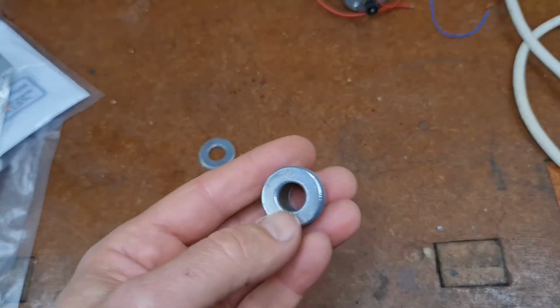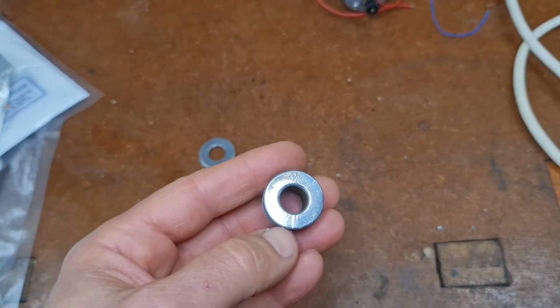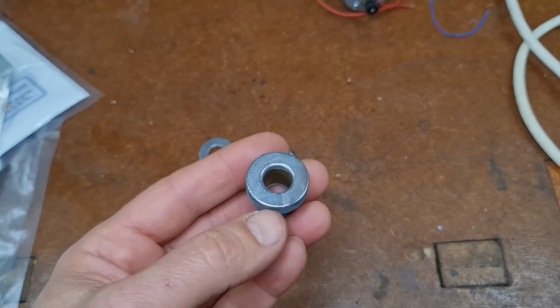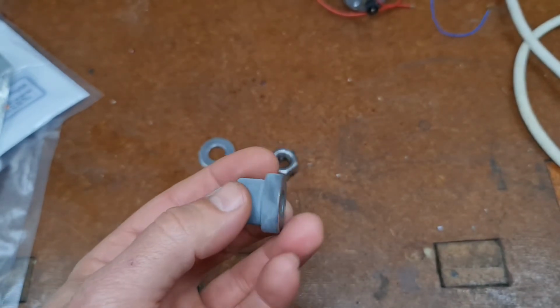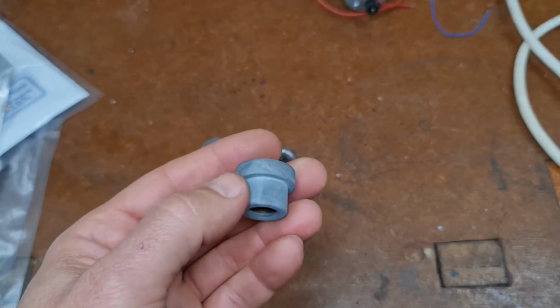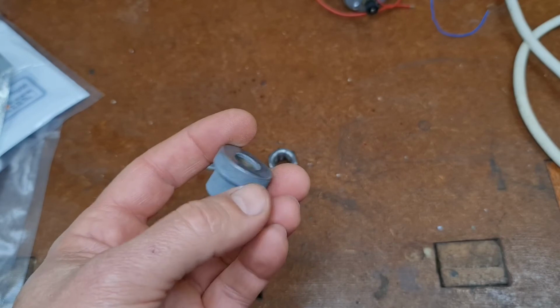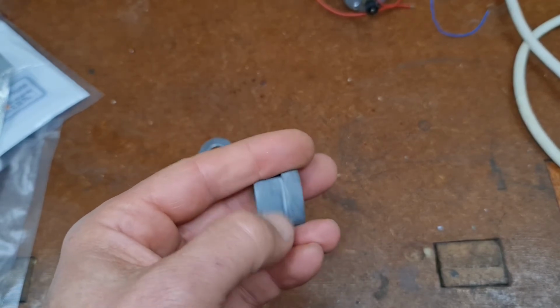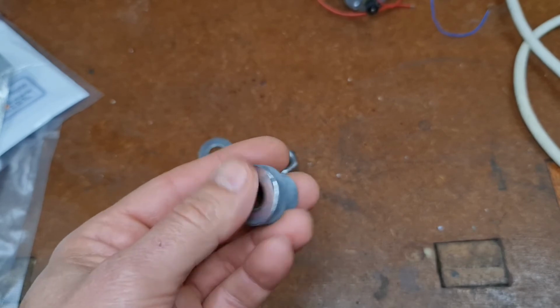Also, with the power supply, I've only got a phone charger. It's either on or off. It's very difficult to control the current. This one, what happened here is it really built up. You can see a very dense coating of zinc, and it's very rough. It's almost like sandpaper, and it took me a while to buff that back.